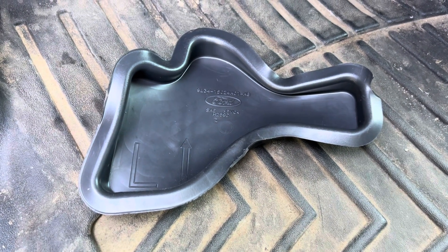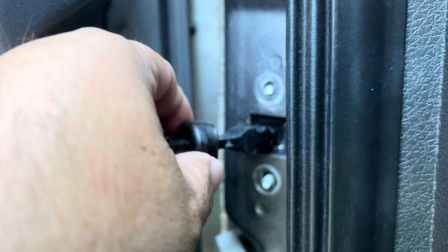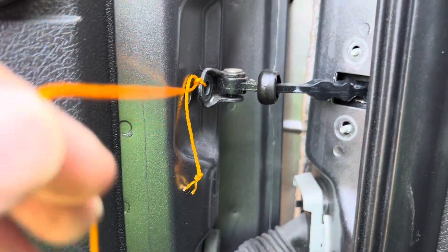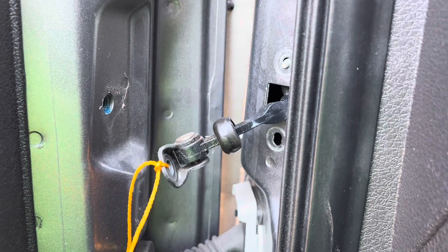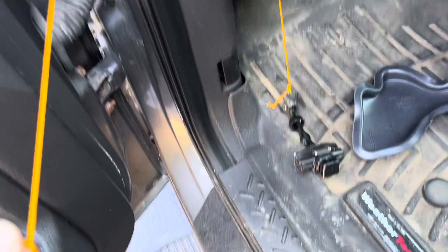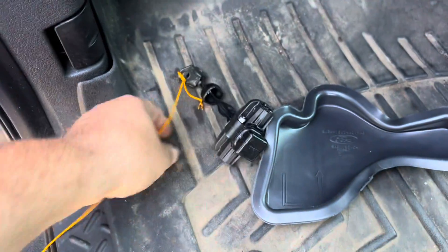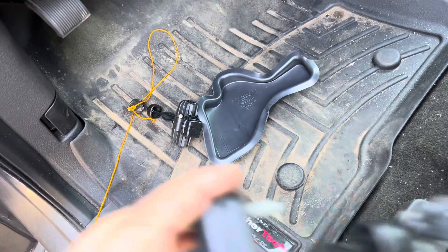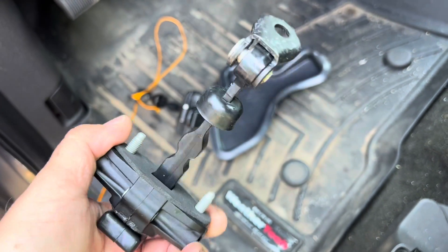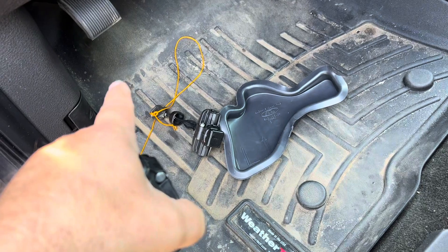The piece is now removed. Reach your hand up underneath there and you will feel the mechanism itself. With your one hand, go ahead and grab it. Make sure your string is attached so in case you do drop it down inside that double-walled cavity, you can retrieve it. Within minutes you can have that door check completely out — your string is still attached in case you dropped it — but you basically just pull it back through. Whenever you want to reinstall, keep the string on the outside here in the cab.